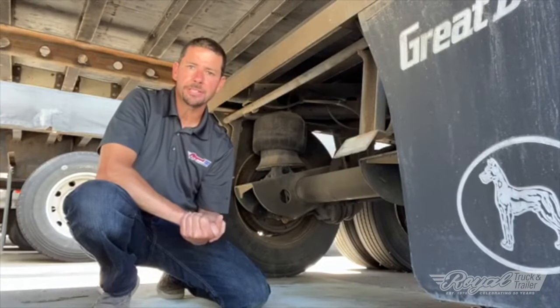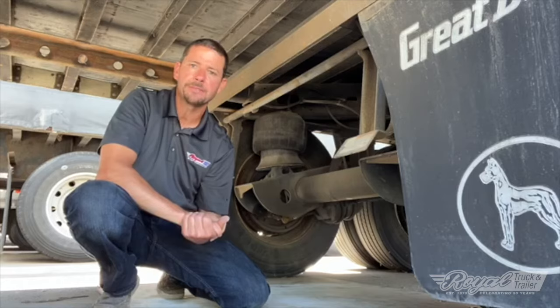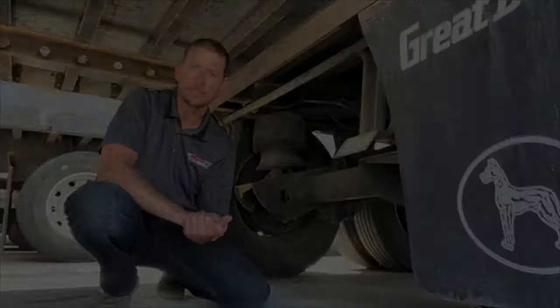So today we greased and adjusted our brakes on this trailer. We know we need to grease our trailers very often, but manually adjusting the brakes is not good for the slack adjusters — that mechanism does not want to back off, as you heard by that grunting noise. As long as your brakes do not throw pushrod travel of more than two inches, your brakes are in adjustment and don't need to be manually adjusted. If you have any comments or suggestions for future videos, please leave them below. Thank you and have a great day.